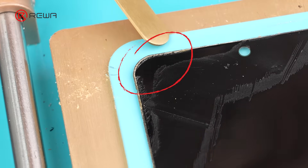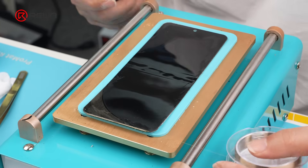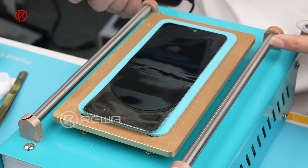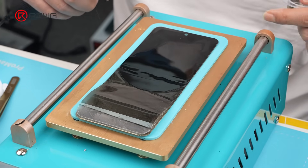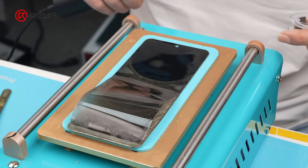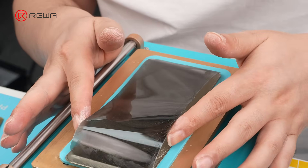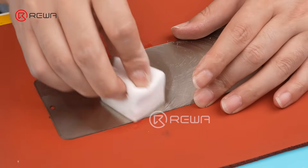We confirm that the yellow tint was caused by a damaged screen polarizer, so further screen separation is required. Then use a 0.028 mm cutting wire to separate the polarizer layer — keep the cutting wire parallel during the pull. Separate the sides of the screen first while pulling, then move on to the center. This step requires some patience. Using a sponge with a specialized liquid to continue cleaning the remaining adhesive.